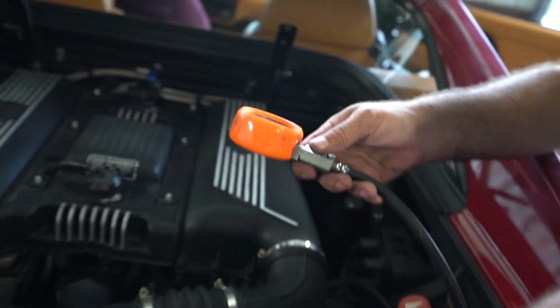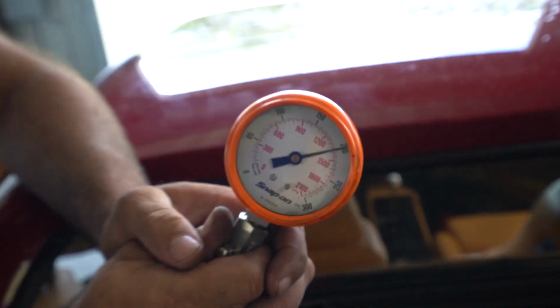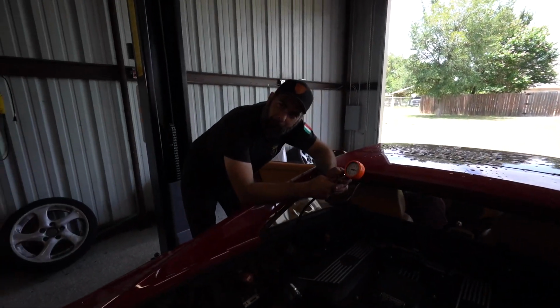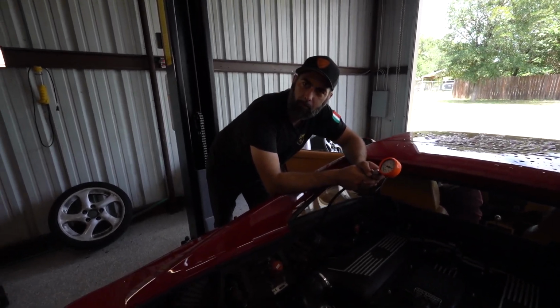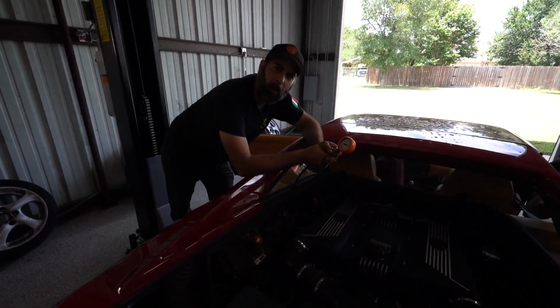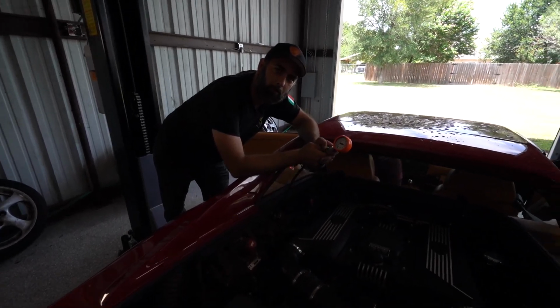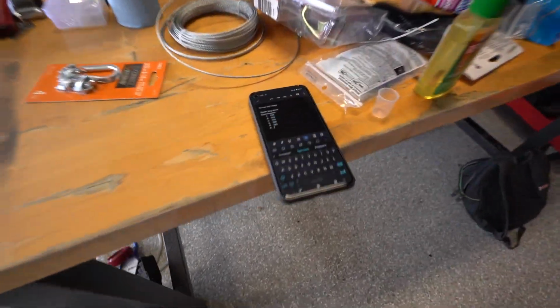165. We're on cylinder number 6 right now, and we have 200. So what was that we were talking about earlier, Dan? Recap for our faithful watchers. So basically the oil is washing into the cylinder, causing the rings to seal up too good. Correct. Now what cylinders do we anticipate that was likely to show up on? Number 6? 4 and 6. Yeah, we're on number 6.